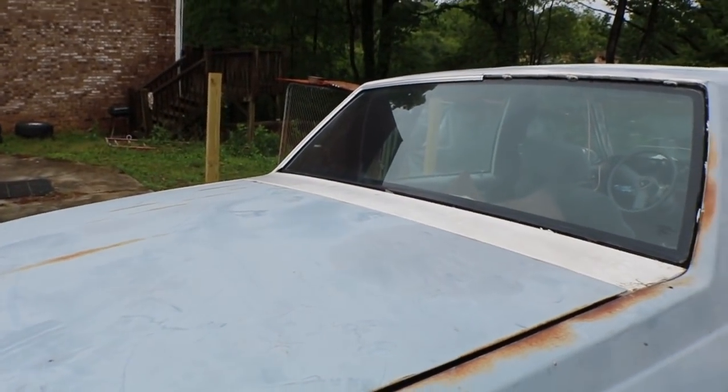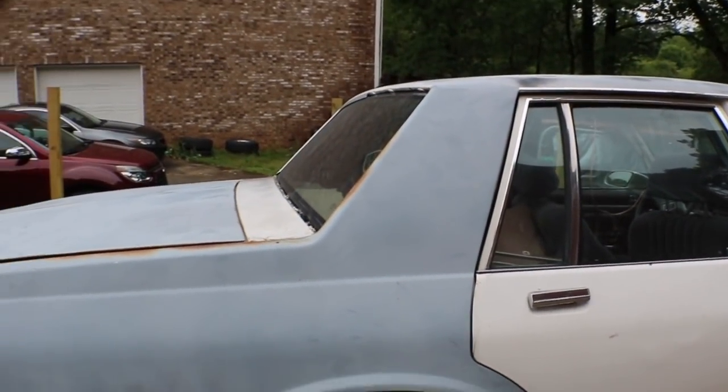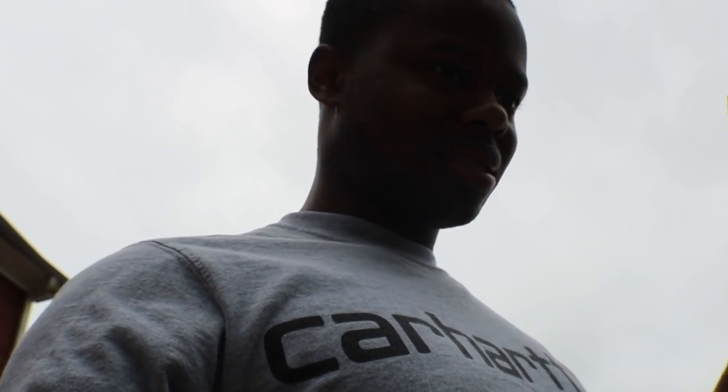Back in 2017, I was like, yeah, I'm gonna get this thing to the bare metal, right? And I flap disc it and used the grinding wheel, and I got a whole bunch of little marks. I don't know if y'all can really see it, but yeah, probably can't. Now in doing that, I never use a flap disc or grinding disc to get paint off. Some people do it, but I just don't like how much metal it takes. It actually takes off a whole lot of metal, so I'm not doing that no more.